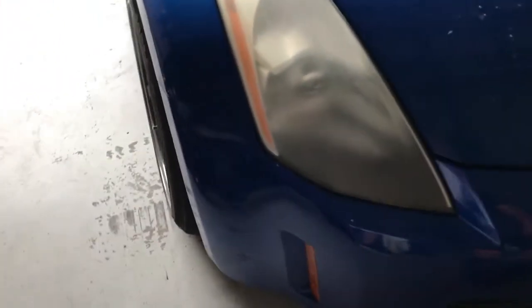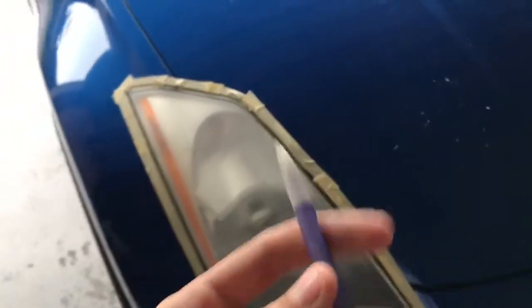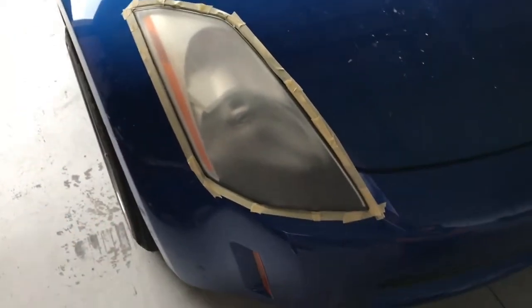You're probably gonna be a little scared when you see your headlight like that, but the clear will definitely make it a lot prettier. Just get all in the corners, make sure it's completely dry and clean. I like to use a plastic pencil to make sure all my edges are good and none of the tape is touching the headlight itself. In a perfect world we'd use actual masking plastic, but since most of you guys aren't actual painters, just get some newspaper wherever you can find it and throw it on. Always want to get a good outline first.